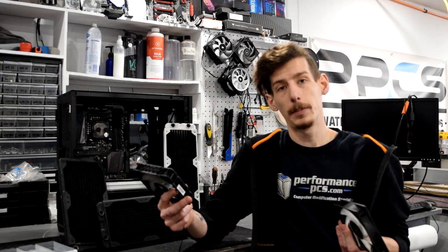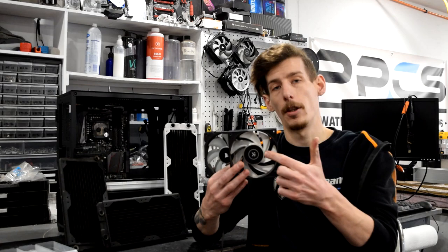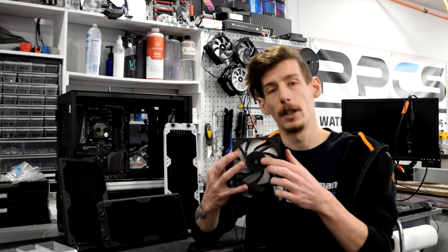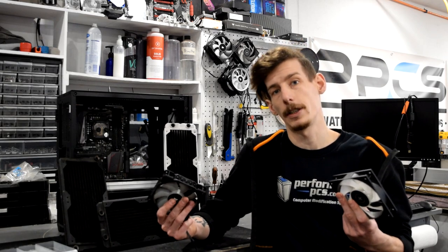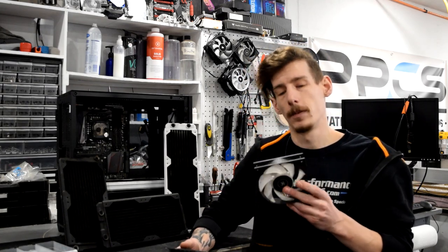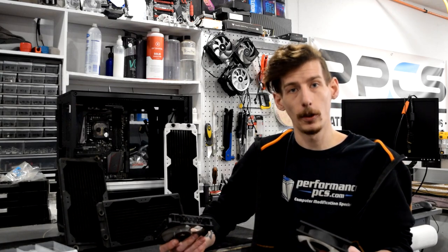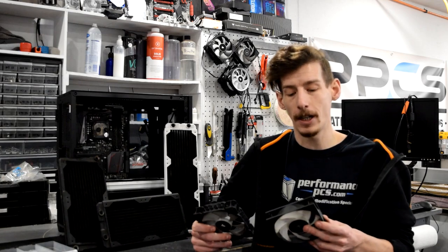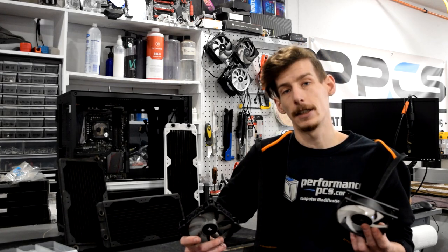For any newcomers: when setting up your fans you want to make note of which direction they're facing. The fan hub or face of the fan is the direction it's pulling air in, and the back of the fan — where you can see the back of the motor — is where it's pushing air through. There's debate on whether push or pull is better, or push and pull combined. Push means mounting the fan on the front of the radiator pushing air through it; pull is mounting the fan on the back to pull air through. I typically don't recommend push and pull combined — it adds a lot of thickness, and you'd be better off choosing a thicker radiator or a higher static pressure fan instead.